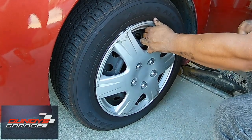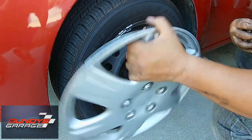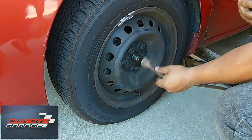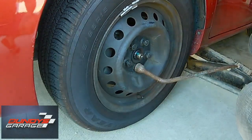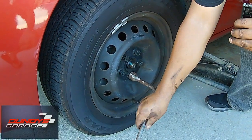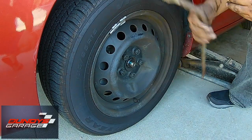But before you start putting it fully in there, you want to loosen up the lug nut. First thing you want to do is remove this diamond plated hubcap — just grab it and yank it out. These are 21 millimeter. We have our lug wrench from the car itself — just work that out. It's probably the hardest part of the whole job.